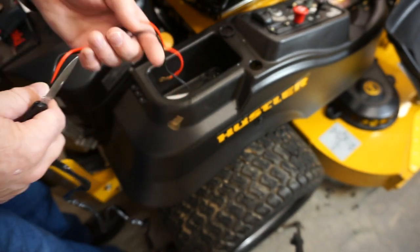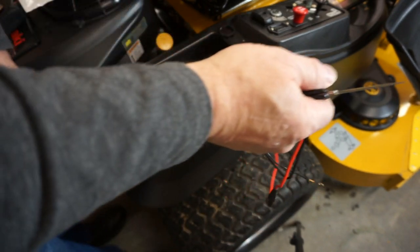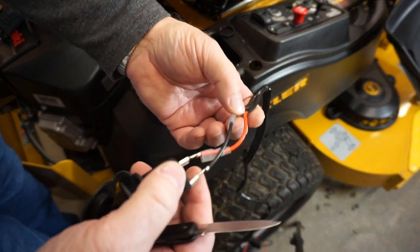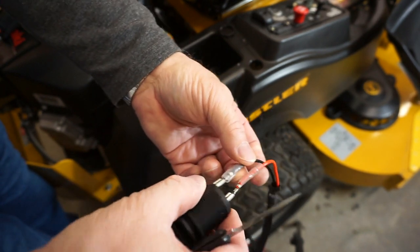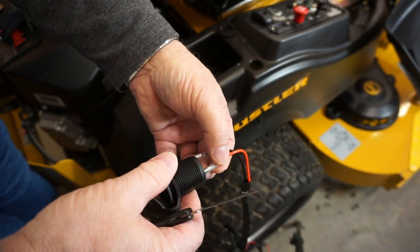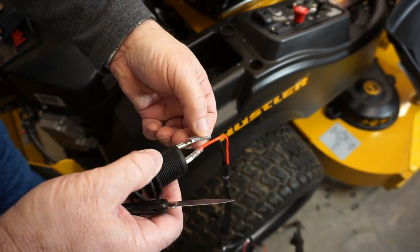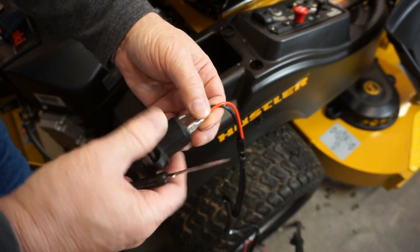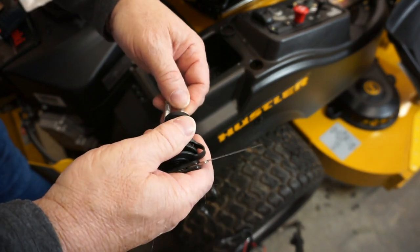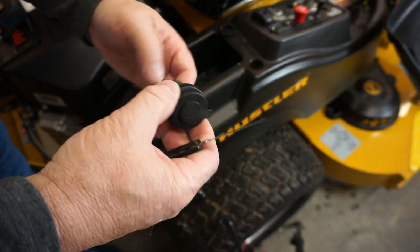We'll check all the machinery that we may run with this thing. We'll see whatever the amperage is. We'll probably put a load test on this wire and just see what the little sucker will take. And here's some of these ends, as you can see, that you can make up yourself. This is really the cheapest way to go. I don't particularly like these, and if you're going to use them, then I recommend that you put a little bit of silicone in there to seal it off, and then disconnect these, put a little bit of dielectric grease in there to make a continual great contact so that you don't get any moisture in there, and that'll keep that good and tight.